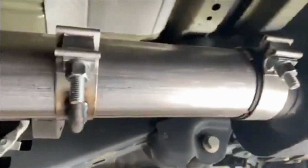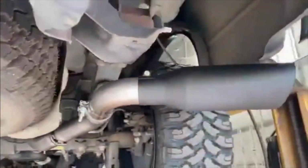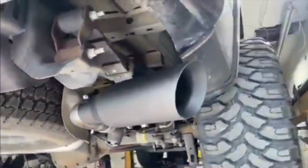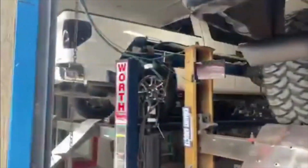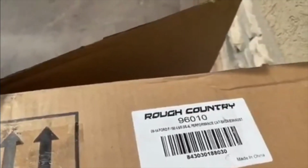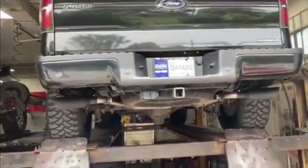They were clamped there, there, there, another clamp there, then the tips were clamped, and then the tailpipes were clamped. Too many clamps, so you always want to put tacks on the clamps so they don't rattle off or break off with the vibration. But there's that kit. Came out really nice, really beautiful. 4-inch tips, black. Part number on that is Rough Country 96010. If you guys want it, there'll be a link in the description. We'll let you guys hear it in a second. Hope you guys like it.